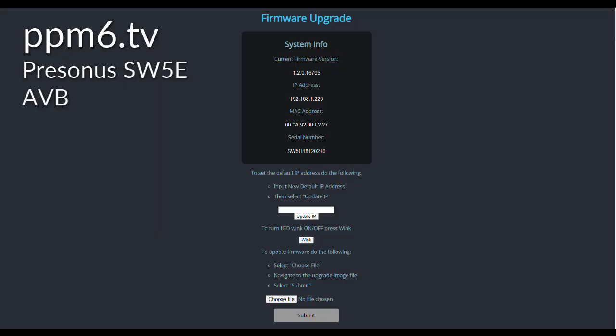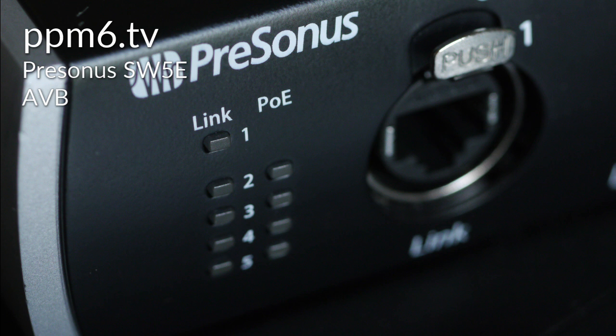In one sense, the switch is just like any other switch — you can plug it into your home network or any IP network and it behaves itself completely. You can assign it an IP address, or it'll be automatically assigned one over DHCP, and then you can log in and see what's inside. Inside there's some network information and the chance to update the firmware. But the key point is: if you want to run an AVB network, you need an AVB-capable switch. You can't just buy a standard switch off the shelf at Best Buy and hope it'll work — it needs firmware that supports AVB functionality, which is why you need specialist products like the SW5e.